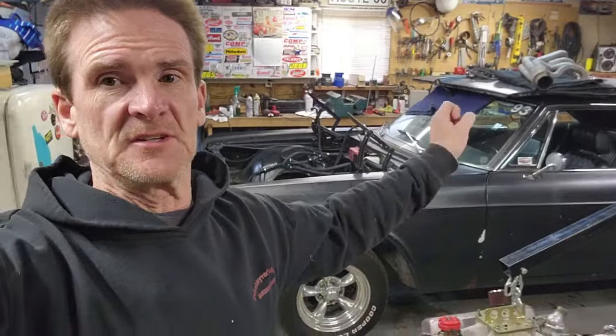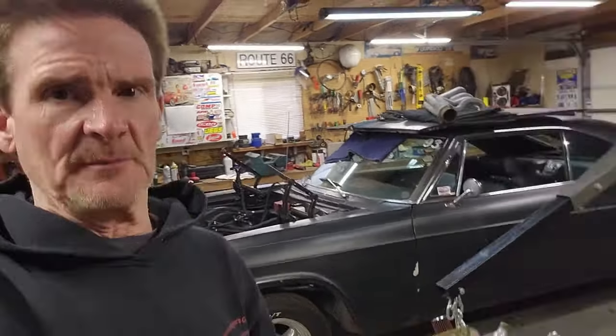Welcome back. It's the next morning. Last night I got the engine and transmission out. They're on the floor. So the next step today is to figure out what I did to the clutch, and that means getting the transmission off the back of the bell housing, taking the bell housing off, and looking at the clutch and such. So I need to get the engine and the transmission so I can move it around a little bit. So I was thinking about using that.